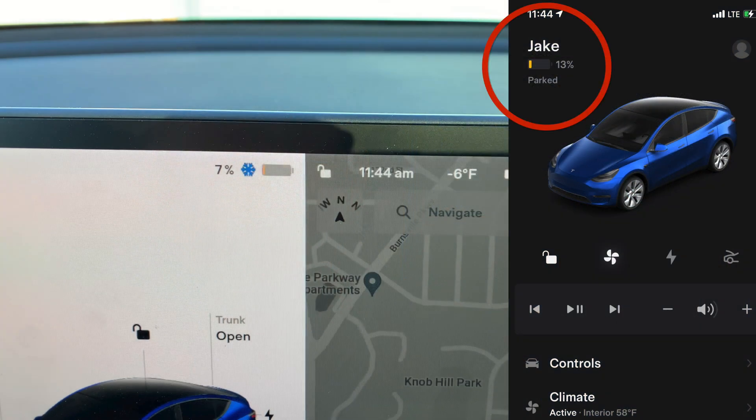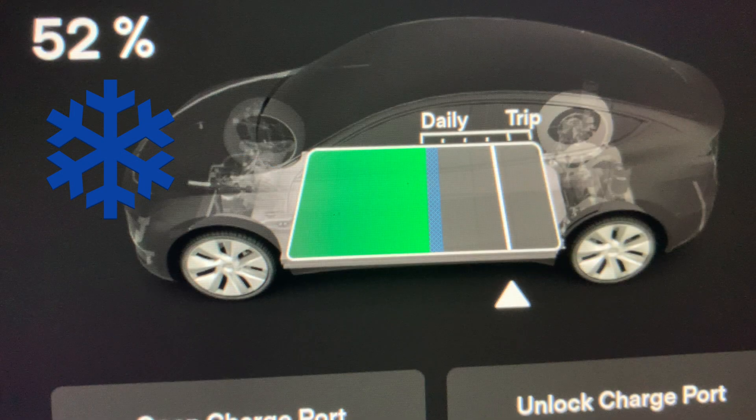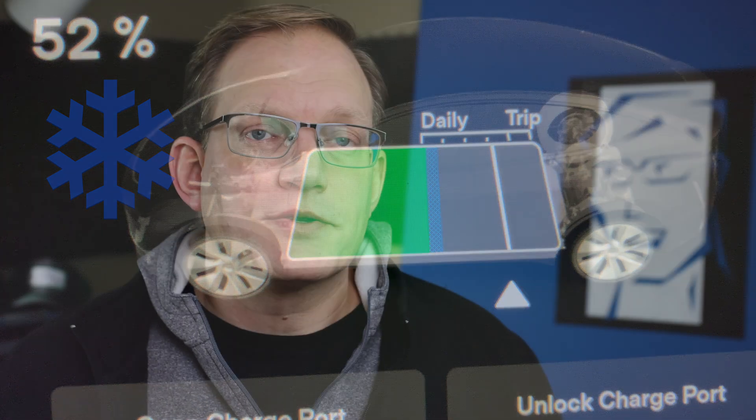In last week's stranded-in-the-cold test, I noticed a big difference between the state of charge I was seeing on the app and what I was seeing on the screen. My data in the middle of the night took a big drop-off when I started reading the screen. Because I noticed this, I started charting toward the end of the test. That difference seemed to represent the battery getting colder — I was starting to see the blue snowflake, showing that part of the battery was currently unavailable because it was too cold. On the screen, we were seeing the actual amount available, but in the app, we were seeing the theoretical amount of how much should be there.